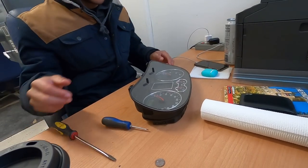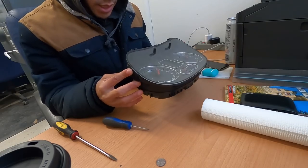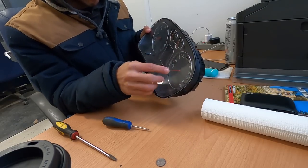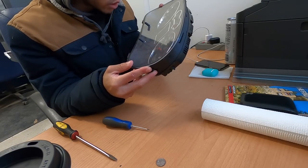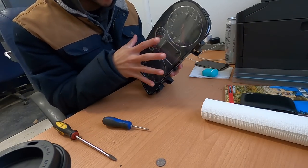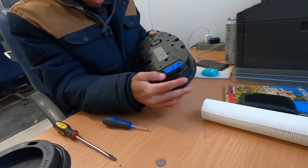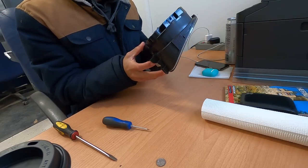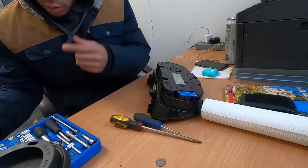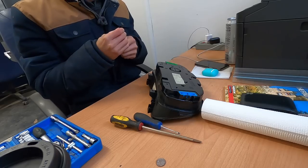This will be my first time pulling apart a Mark 4 cluster. Since it's not actually going in my car, if it breaks it's kind of okay — I just need the chrome rings out intact, which looks like they're in good shape. It's already kind of cracked on the outside. I'm not sure if this front lens comes off or if you go from the back side. We've got four little T15s — maybe. We'll start there and try from the back first.